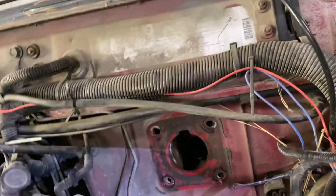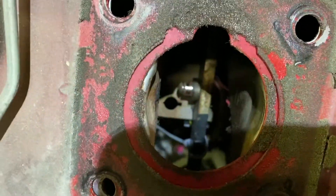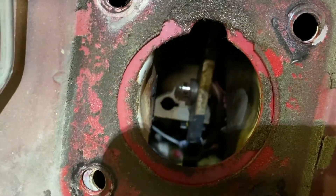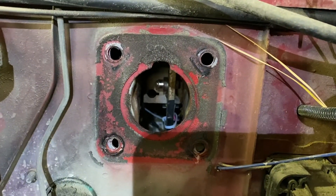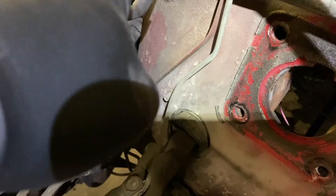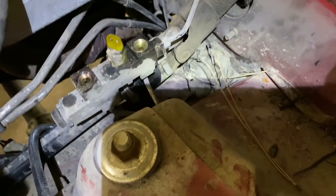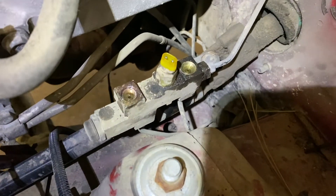In the engine bay itself, you can see that's the button or the shaft on the top of the pedal. I've got to make sure that bolt pattern is going to work. There's the proportioning valve. This line goes over to the passenger side. This rear line goes to the driver's side. And the large line down here on the bottom goes to your rear brakes. We'll get that prop valve out of there and see if we can get the new stuff in.